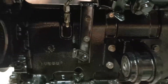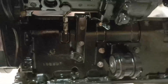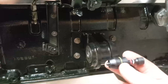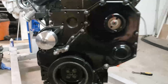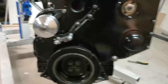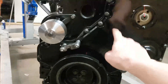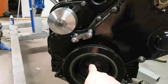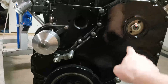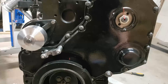If you're used to working on any engine, the first question I had about this whole process is: how do I know if I'm truly at top dead center, or if I'm 180 degrees out? It wasn't until I opened the timing cover that I fully understood what was going on. Your crankshaft sprocket is half the diameter of your camshaft sprocket. So for every two rotations of the crankshaft sprocket, it only amounts to one rotation of the camshaft. That's how you get this little dowel in there at top dead center every time, and you don't have to worry if it's 180 degrees out.